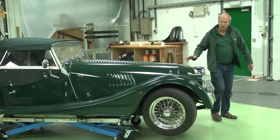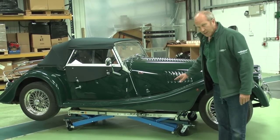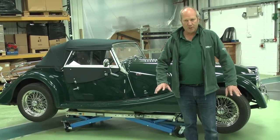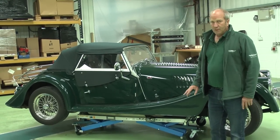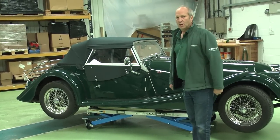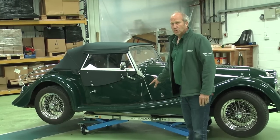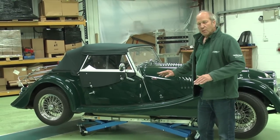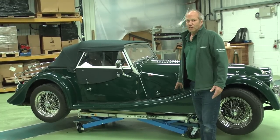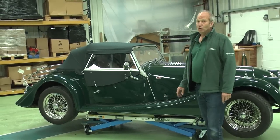This is a beautifully made American lift with excellent quality engineering. Traditional lifts like the one behind us are very heavy, with a big hydraulic motor — they're great in many ways, but this has so many more advantages. When you're not using it, it can hang on its own wall plates and literally only takes up four inches. There's no big, cumbersome hydraulic motor. It's a little bit slower going up and down than hydraulic lifts, but when your car's on the lift for three or four hours, the difference of a couple of minutes at either end is neither here nor there.